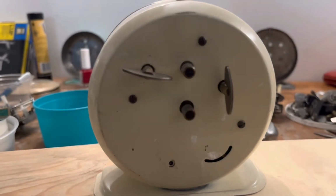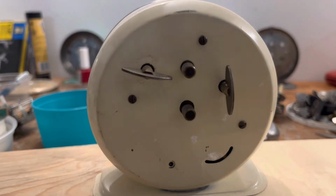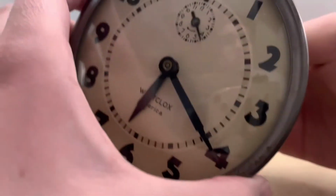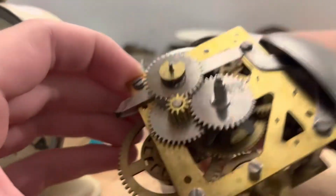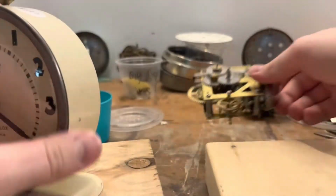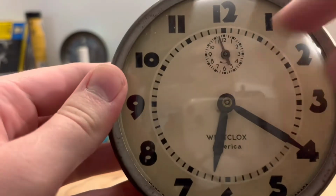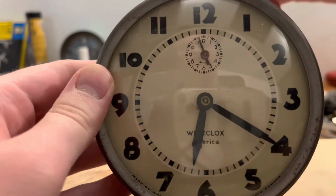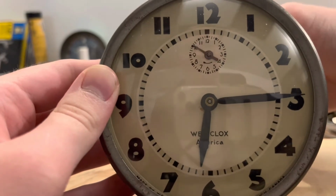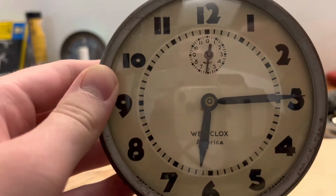And as you can see, we got our time setting knob and the alarm setting knob. So what you want to do, of course, put the dial on, stick the alarm hand on any which way. So let's say it's just on there like that. And then before you even put these two hands on, you turn it around. Oops. Turn it. You hear a click.